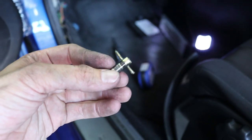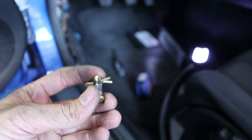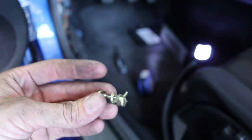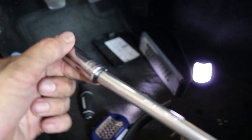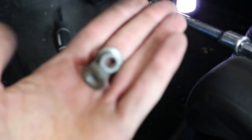Here's the little pin - this is the one I had to take out first and it just slides right out. Now all I have to do is take the two 12s out and that's it. This is basically what I used to take it out: it was a 12 millimeter deep socket and a swiveling extension. Here are the two 12 millimeters - they weren't too terribly difficult to get to, I thought they were going to be a little harder but they actually weren't. This should be pretty much free to come out now.